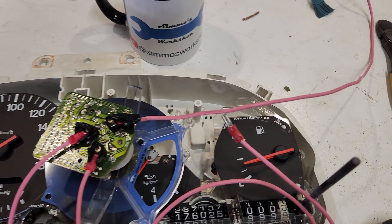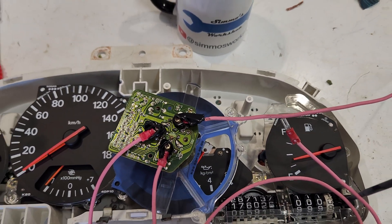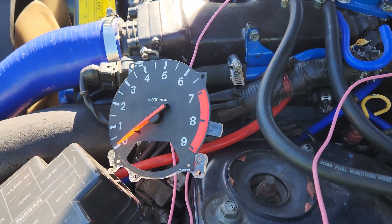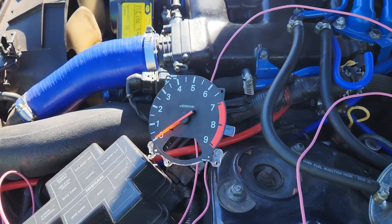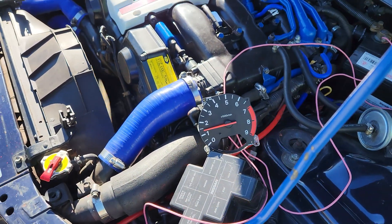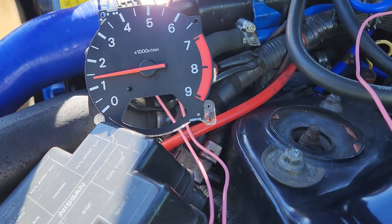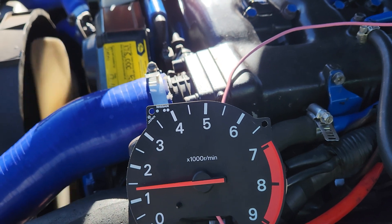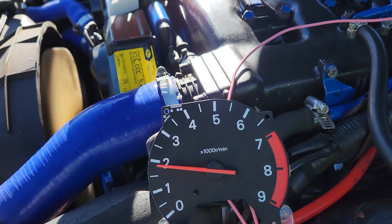Using three wires, some eyelets and some insulating tape, we're going to test this gauge to make sure it works — and we can test it using the diagnostic pin on the car itself. I have ignition on the positive side of the battery, I have ground on the negative side of the battery, and I have the signal plugged in to the diagnostic signal that we tested earlier. Apart from being a little bit bouncy because it is laying on its back and the engine is creating a bit of vibration, the gauge is working perfectly fine. It's idling a little bit high because the car is quite cold but the gauge is working how it should.